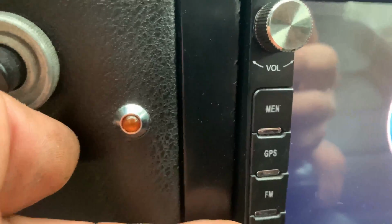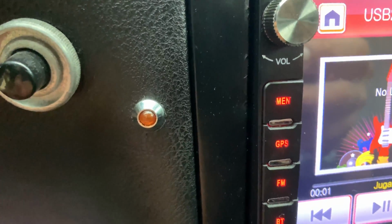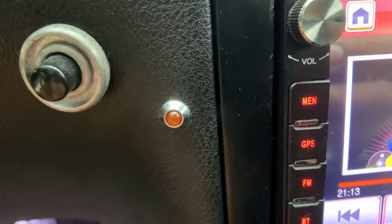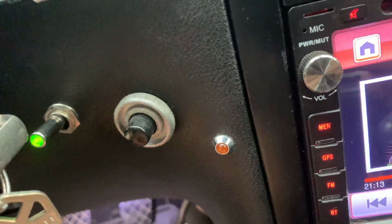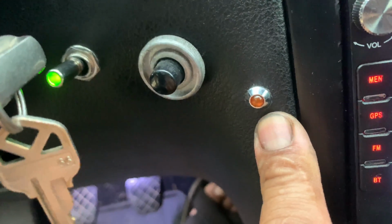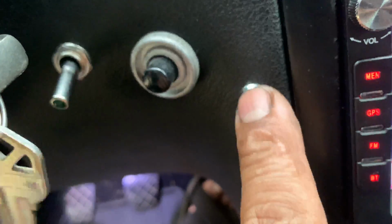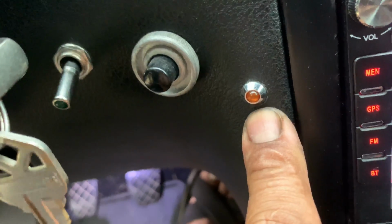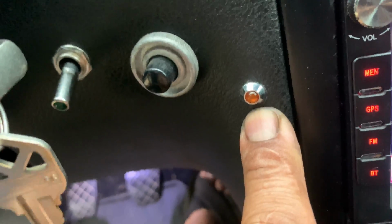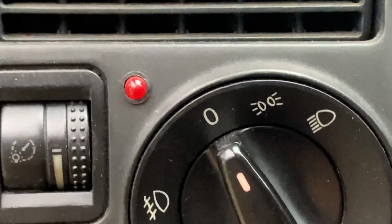I don't know if you're gonna see. That's spraying propane. When you get to some boost, it will spray propane. So you can set it at whatever boost you want. You can turn it off right here. Once this is off, this light doesn't matter how much you rev, it won't come on. The one that comes on is my water methanol injection. This one.